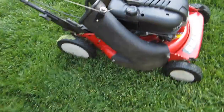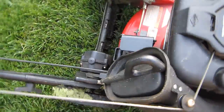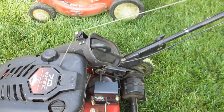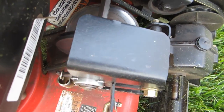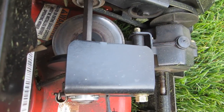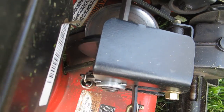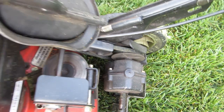There's also a mulch plug in here, which I didn't take out, but I got one in mine — it looks like this, so you can leave the bag on. This is another reason why I like Snapper: the self-propelled is just on a drive wheel, kind of like an old bicycle — a hard rubber wheel that slides up and down to vary speed. It's a very simple transmission with one belt that drives it from the engine through a little gearbox — very simple design.